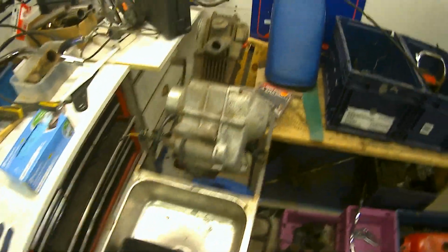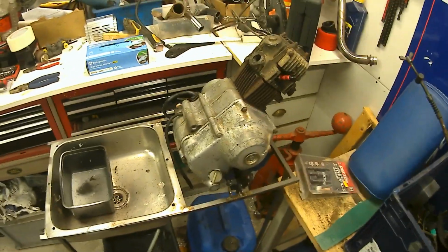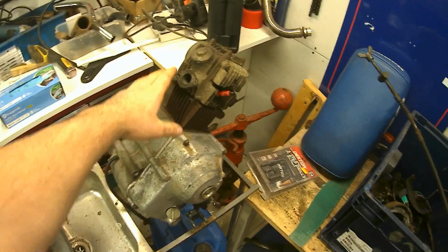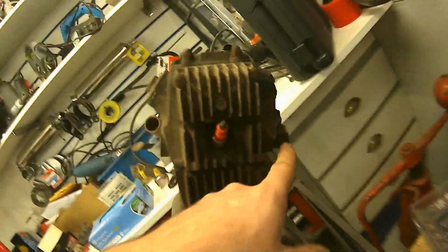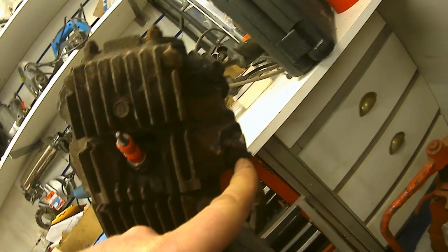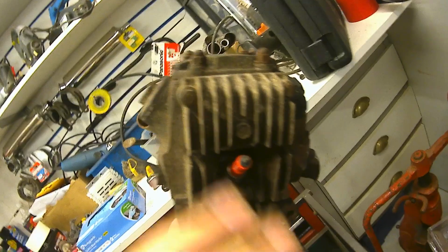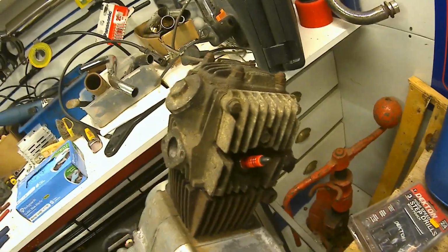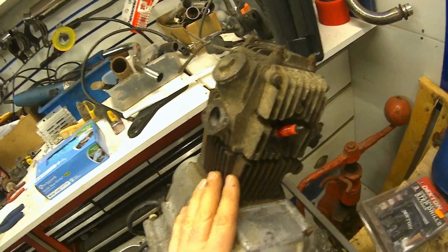I built a little engine stand so we can sit and build an engine up. So this is the original ATC 4-speed. I'll give it a quick clean and a wipe. I'm going to put the 88 barrel, because the exhaust would not come out of the barrel at all, out of the head. So that's completely seized solid in there. I tried grabbing it and for now I said this head is finished. I could probably sit and persevere and try and get it out, but just for time, I've got a big valve head anyway and an 88cc piston in another engine.